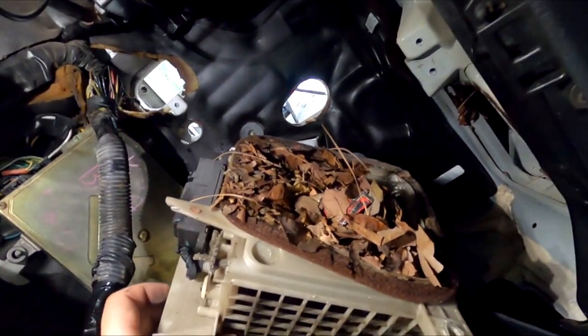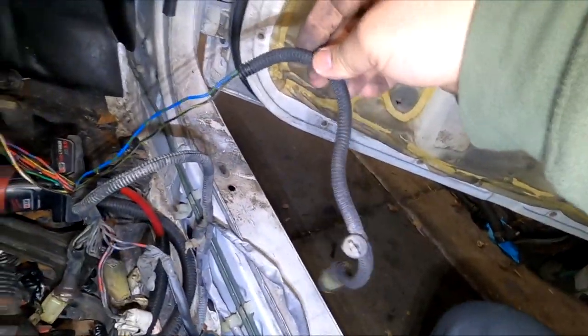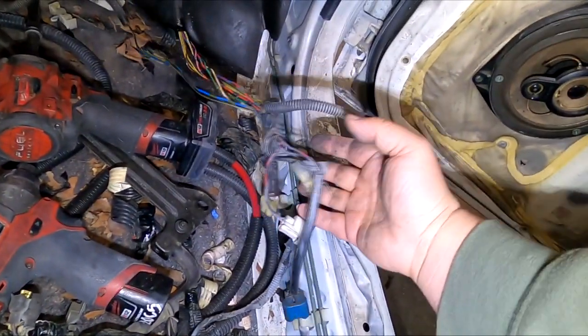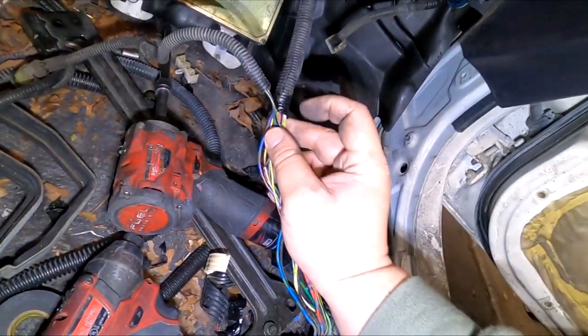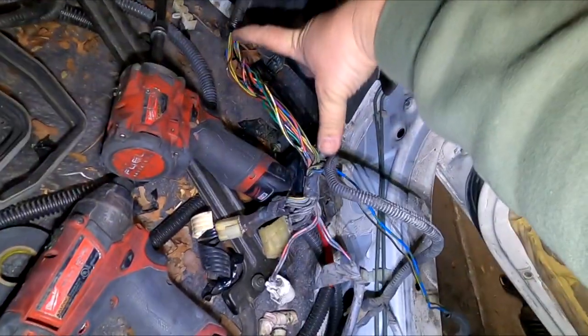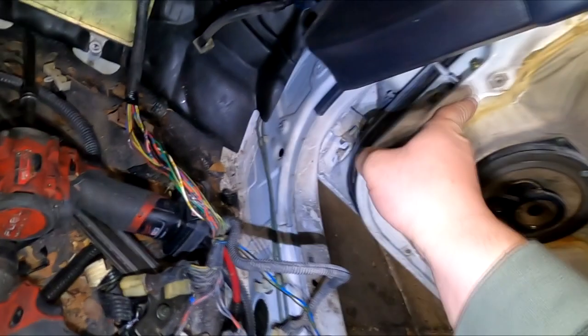Oh my freaking... update. So this plug is for the fan, and this sat way up in this joint right here, which is way far from all of the other wiring and plugs. So what I did was strip it back and then pretty much undid the electrical tape that was right there to pull the fan plug all the way forward, so that we gain some more slack right here, because this section of the harness is not going to be going through the passenger side.